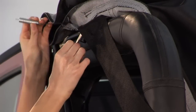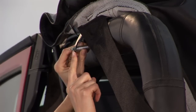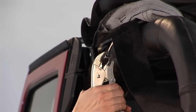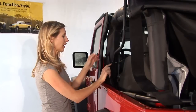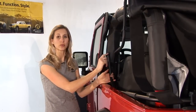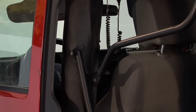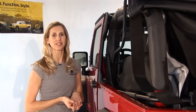Attach the cable spring to the bracket on the bow, then crimp it into place once it's on. Next, attach the side bows to their bracket, and the rear bow attaches to the bracket that has three holes — that's so you can adjust the top later. For now, put it in the hole closest to the sport bar because it'll be the loosest fit, and you can always come back and tighten it up later.